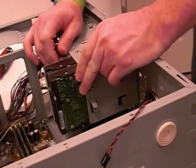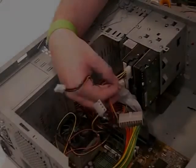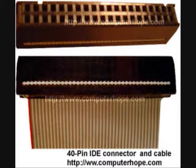Start by connecting the Molex power connector to the hard disk drive. This connector has two slanted edges and can only be inserted in one direction. Once done, connect the IDE cable to the connector. Like the power connector, this cable is also keyed either on each side of the cable or will have a small bump on the top, allowing it to only be connected in one direction. Some older computers and devices may not be keyed. In this situation, notice how one side of the cable is red — this indicates that this is pin 1. Match this up with the connector's pin 1.